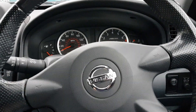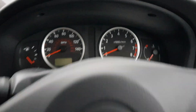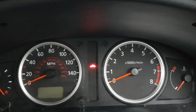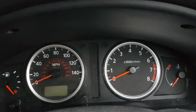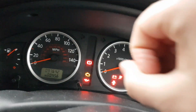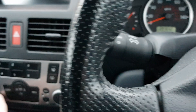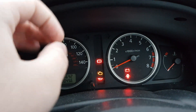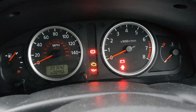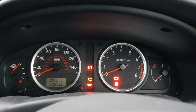The engine is relevant in this. The issue I've had is that the immobiliser light — that you can see flashing there in the middle — has been occasionally, and going more and more frequent, flashing very quickly for about 3-4 seconds when I turn the ignition on, and then it would just go solid and stay on. Whilst that was on, I could not start the car. When you turn the key to the start position, it would not crank — the starter motor would not engage at all.